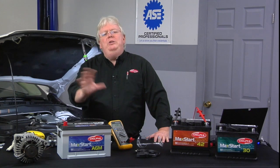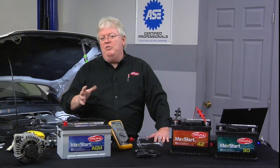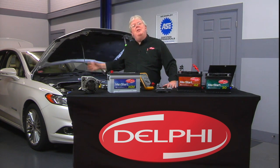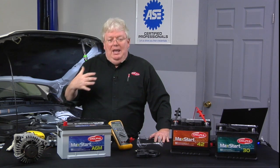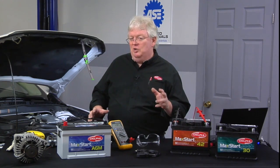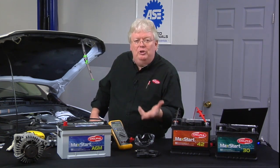Now let's talk about when you charge batteries. State of charge is when you go to action and start charging — either with the vehicle's charging system, which is typically the best option because the electronics on today's vehicles understand taper rates far better than a portable battery charger, or using an external charger. State of charge is essentially the open circuit voltage of the battery.